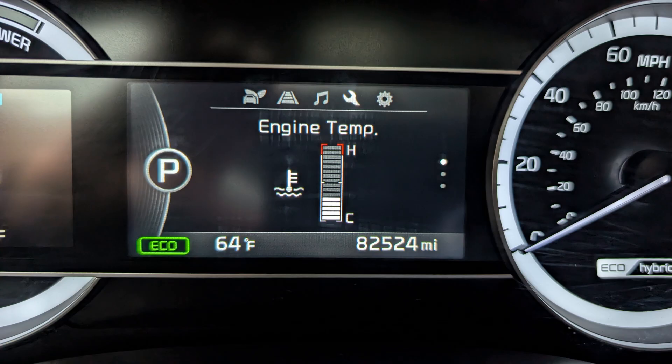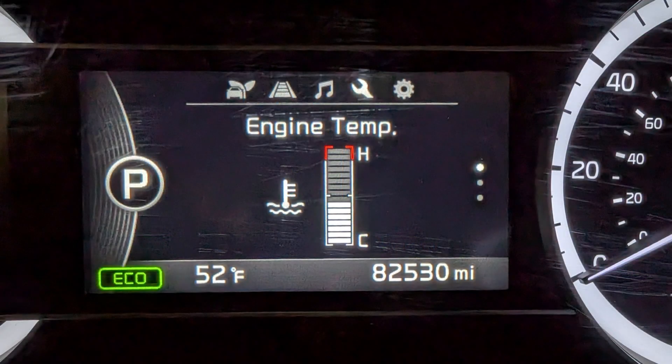There's a risk that bypassing the heat exchanger will result in the engine operating at less than optimal temperatures, which could result in extra wear and tear and shorter engine life. I have observed that it takes me about three miles of highway driving before I get to the optimal operating temperature — which is seven bars, or just one bar beneath the midpoint on the Niro temperature gauge. I've also observed that I rarely, if ever, get to optimal operating temperature when just taking short trips on surface streets at 25 to 35 miles per hour.